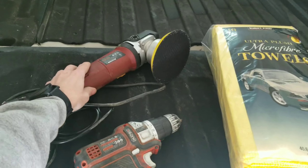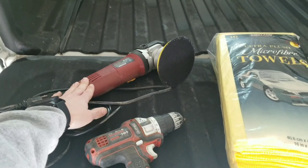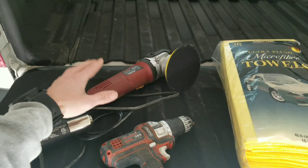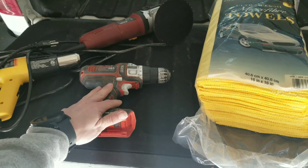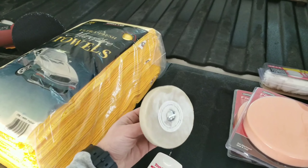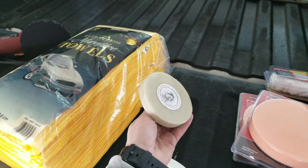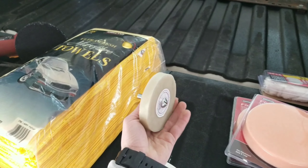You're going to want a DA polisher or buffer after you remove it. A lot of times there's dirt behind the decal or the bumpers and it's going to wear into the paint — you're going to want to polish that out. You're also going to want a drill because you're going to want to grab one of these — a 3M eraser wheel. I'll put a link in the description where you can pick one up.